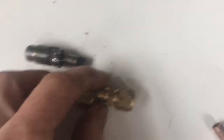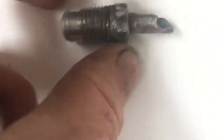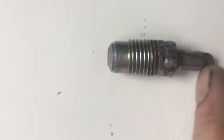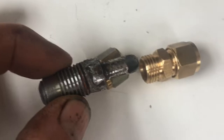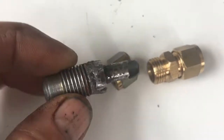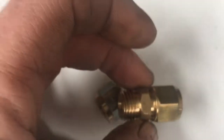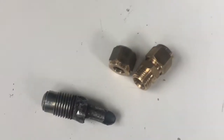What I'm going to try and do — this is Plan A — I'm going to take a hacksaw, because I can't get a pipe cutter in there to cut it cleanly. I'll cut it just there, and see if this will actually fit on with a standard plumbing compression fitting. There's enough pipe left on there. Then all I need to do is cut the other end of the fuel pipe and join it.